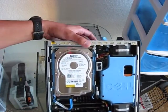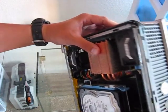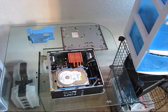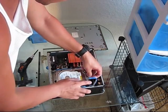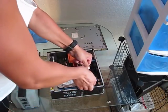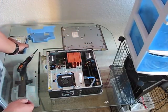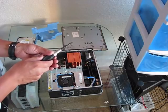Hard drive has to be removed because we are actually doing the deep cleaning. As you can see the heat sink is pretty dusty — you can see it from this angle. Let's remove the hard drive. Disconnect the SATA cable and the power connector. Just simple as that.